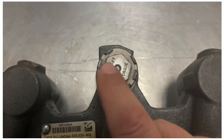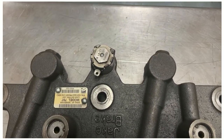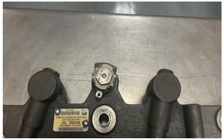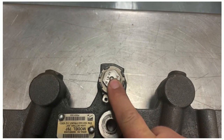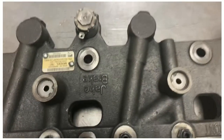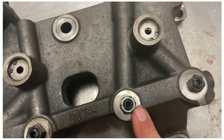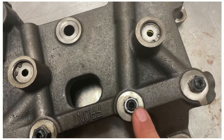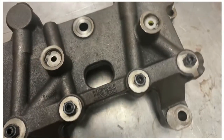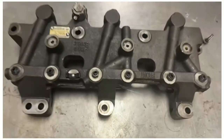On the solenoid there's a button right at the top. If you push this button while the engine is running you're bypassing the electrical part of the system and allowing the brakes to work hydraulically as they normally would. So if the driver said the brakes weren't working and I push this button and they do work, I know I have an electrical issue. If it still doesn't work then I'm looking for things like bad O-ring seals, cracked housings, or improper slave piston adjustment — you have to adjust the lash between the slave pistons and the exhaust rockers to make sure they open at the right time and the right amount. If you misadjust these you either have the valve hanging open when it shouldn't be, or you don't move the slave piston enough to open the exhaust valve at all.